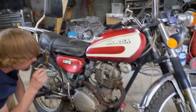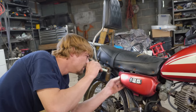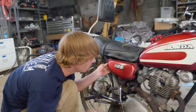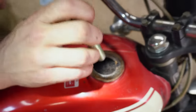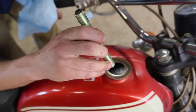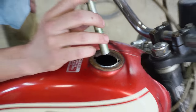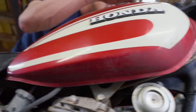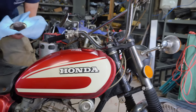So let's pop the carburetor off and see if we can shoot a little blaster or some starting fluid in there and see what happens. Oh man, it's really bad — that thing's as rough as ten miles of back roads. Lots of coffee grounds. If you don't have bubbling on the underside of your tank, you're usually okay. We're going to do the tumble trick on this thing, and that'll be the real tell.